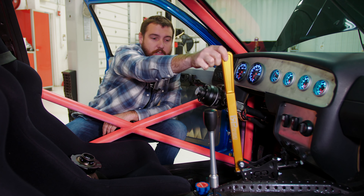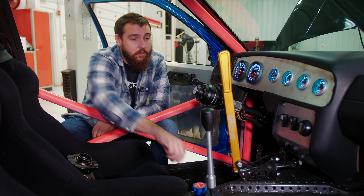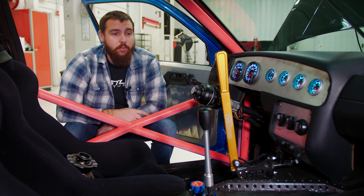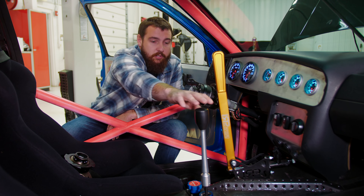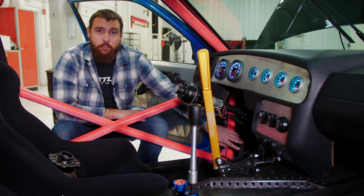This is the intake out of my last car with this engine — I ended up cutting it, reclocking it to get it to work, and adding a mount. Figuring out the coolant swirl pot was the next big deal. The engine is a high point in the cooling system, as is the radiator, so I have to bleed both to get all the air out. Both ports are drilled and go into the swirl pot, and the port from the bottom goes to the vacuum port on the water pump, so it's constantly bleeding fresh coolant to both ends. That's been fairly trouble-free.